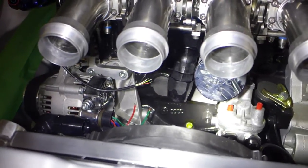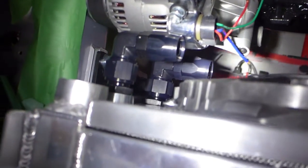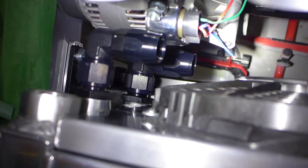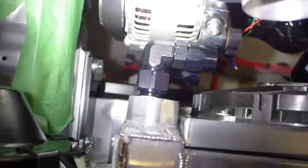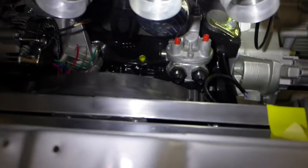There's the dash-16 coming out of the cylinder head, and it now connects down to the bottom dash-16 which clears the fan shroud with no problem. The dash-12 — I've just clearanced it; it's got an air gap to the alternator. I can move it up further out of the way if I have to, but it's clear. That line runs across and connects there, so I can now start assembling all my hose fittings for the coolant and then pressure test.